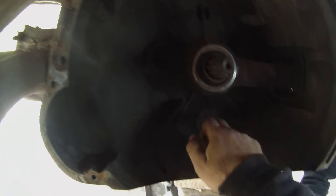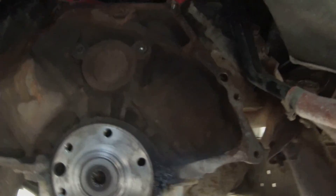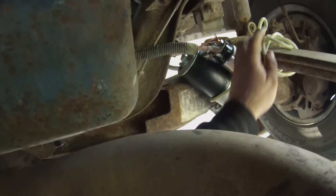That's a pretty bad throwout bearing. His transmission doesn't leak at all - it's really good. It's got the shafts in great condition, nothing wrong with it, no damage. We're going to clean this all up and put grease on when we reinstall it. All the bolts came out. We're going to probably chase these bolt holes. You have to take the starter off of course, and we just hung it up there with a bike lock.